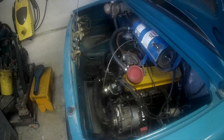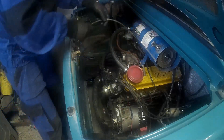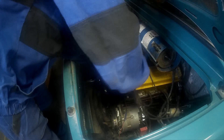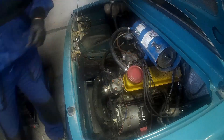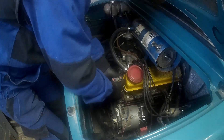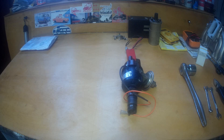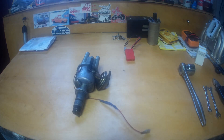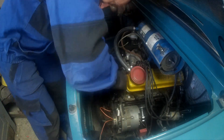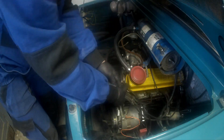I will now show the steps to remove and install a distributor on a Skoda engine. First, disconnect the vacuum line and the sensor connector from the AT011 module, then remove all spark plug wires from the distributor cap. Under the distributor there is a fixing screw that must be loosened — after which the distributor comes out very easily. Once removed, fit the new distributor with the 012CW sensor, connect the sensor to the AT011 module, and reattach each spark plug wire.